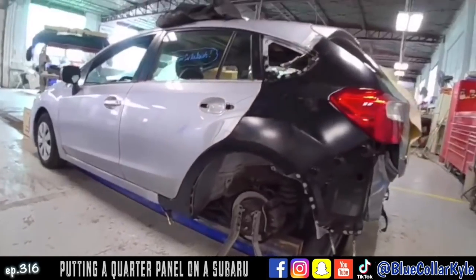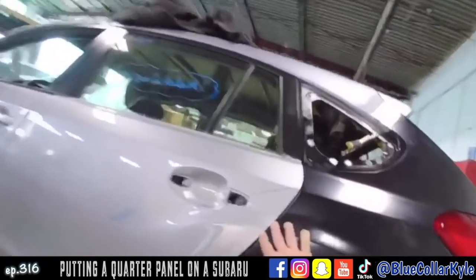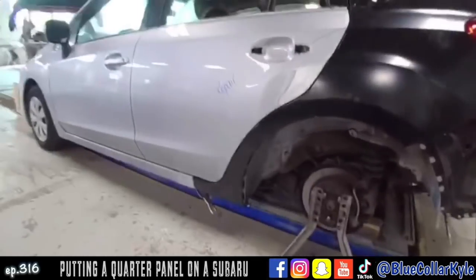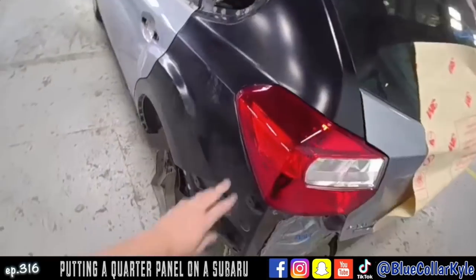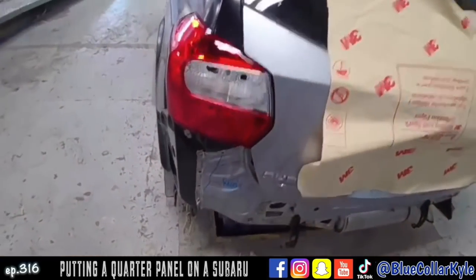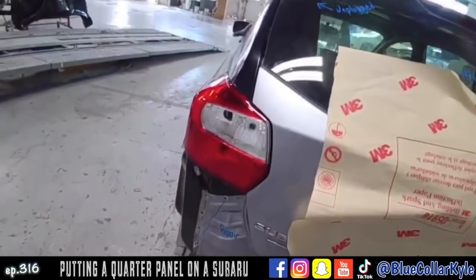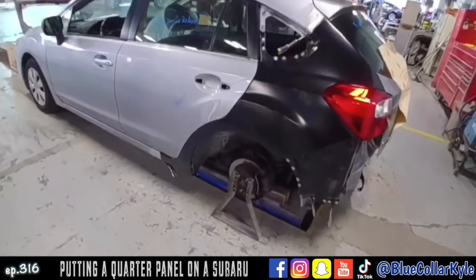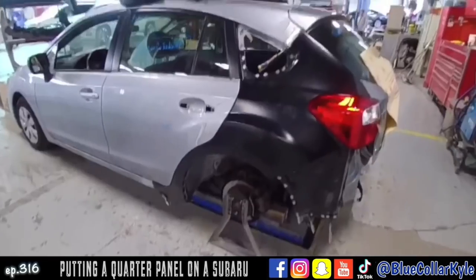Well, I just about have this one all fit together. My door gap is nice and even and consistent, just like the other side. Then my taillight lines up very nicely, as well as the lift gate gap at the taillight there. So everything fits good. I'm going to go ahead and get this all welded together.